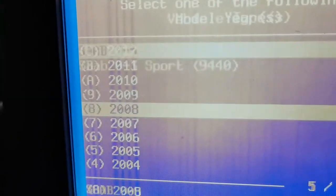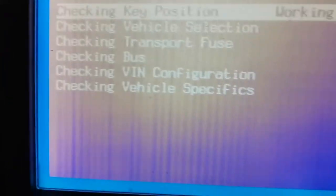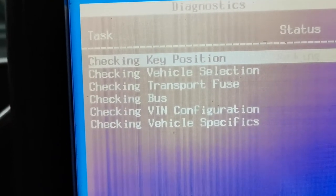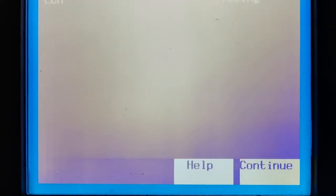Screen's warmed up now. We go into diagnostics — it's a 57-plate so we go to 2008, it's a 9-3 Sport, go down until it says All, then do a global ECU scan. Turn ignition on. It'll work through and come up with the fault codes. These have problems with steering switches, ignition column switches. And straight away we've got — ECM missing. So engine control module is missing.